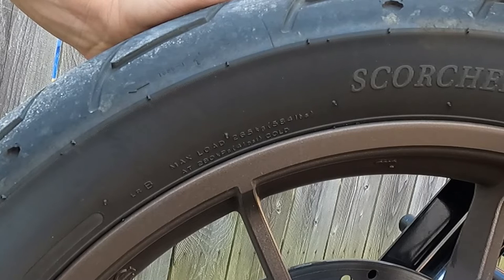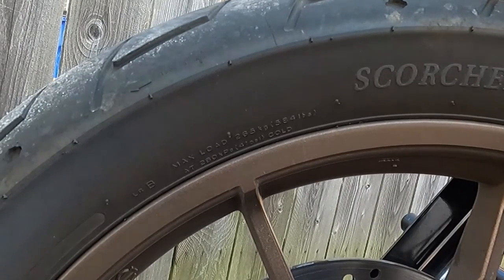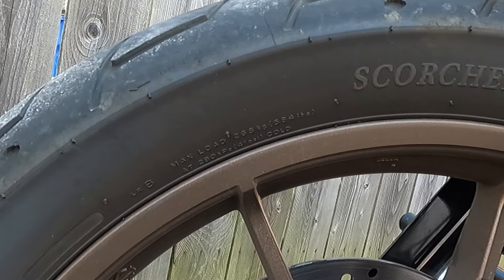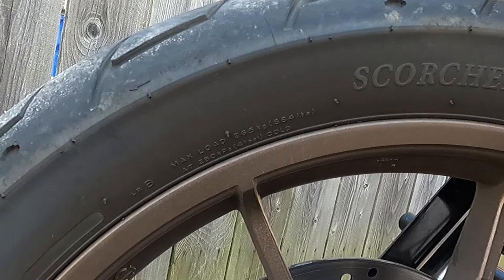Manufacturers recommend you run approximately 75 to 90 percent of your max PSI. If it's a lighter bike and you're really looking for sport handling, you'll go in that 75 percent range. If you're traveling or commuting, you're better off keeping it up towards the 90 percent range. To calculate your 90 percent: 41 times 0.9 equals 36.9 PSI. So the ideal pressure to run in this tire is about 36 PSI.